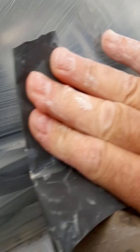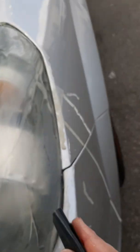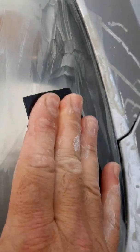And that sort of refined the scratches down a bit. So we can squeegee it off again. See if there's any yellow bits left. Slightly different appearance around the side there, but we can probably get that off actually. See if we can get a bit more of that off. There's a lot of cracks in the lens there, you can see them in the plastic, sort of stress marks. Finish that off with a bit of 1500.